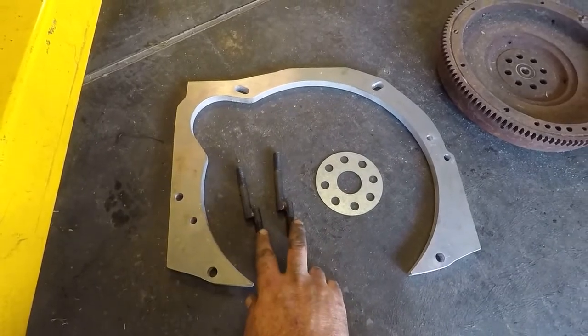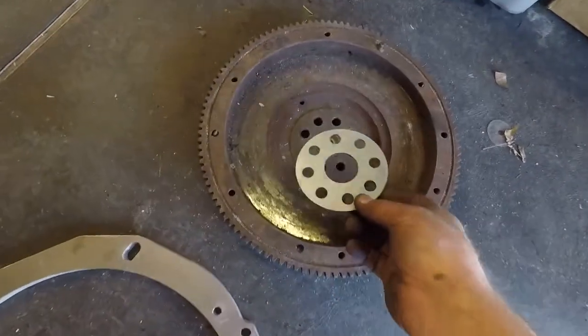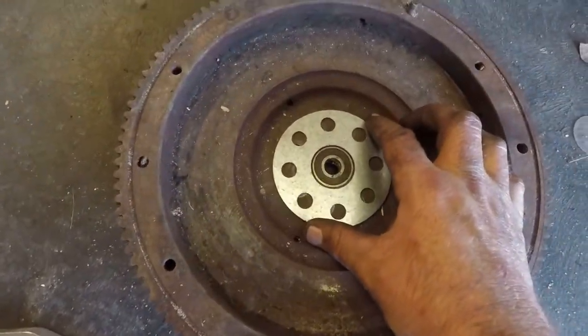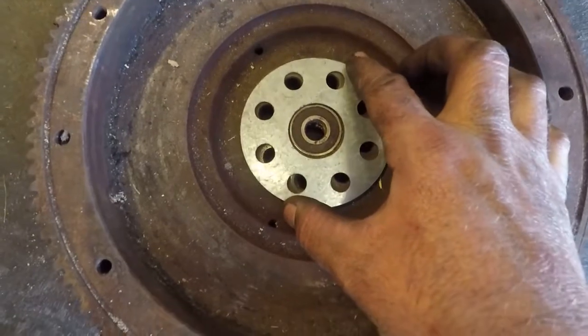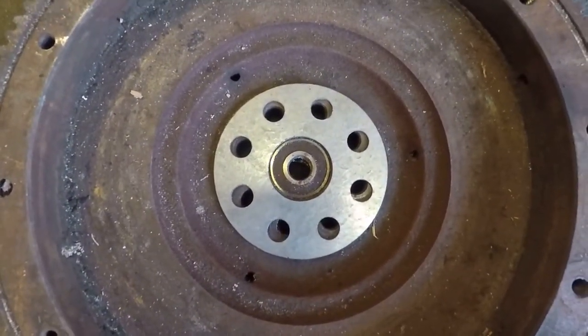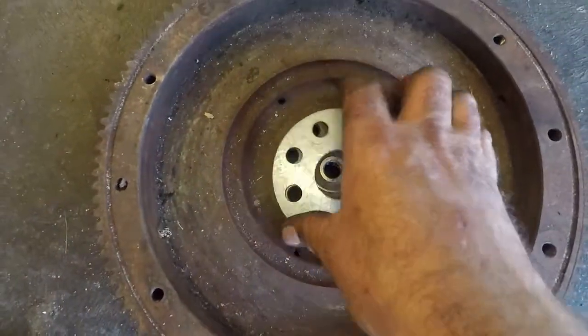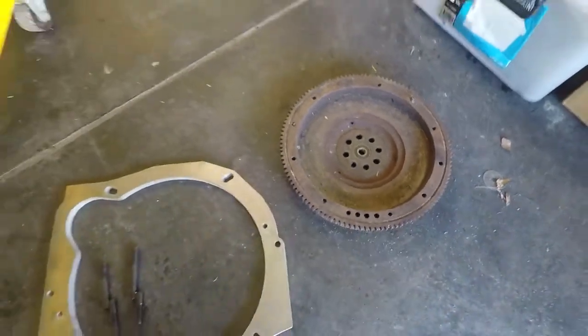It also comes with two offset bolts for the top bolts. Line the flywheel template up on your flywheel as close as you can. You can see what needs to be done — a bit of filing on each one of the bolt holes. That template will help you do that with a die grinder, or a hand file can even be done if you really like arm work.